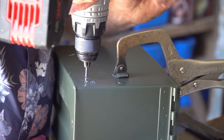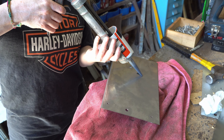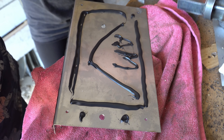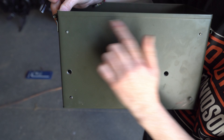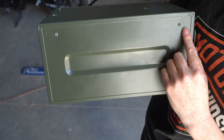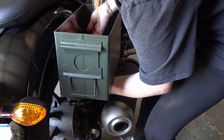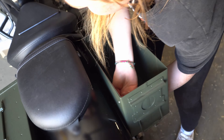Here we have clamped the plate to the inside of the pannier to drill some holes so we can rivet them together. I'm going to silicon it as well. I've got my initials here just so you don't forget to subscribe to AndyMoto. So I've got one, two, three, four rivets, and then two on the bottom. Putting it back on using the original bolts, it feels much more solid. Now I'm going to do the other side, which has the stainless steel plate as well, so both panniers should be exactly the same.